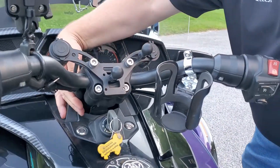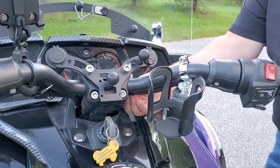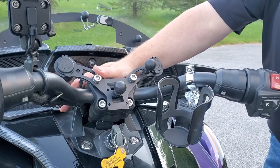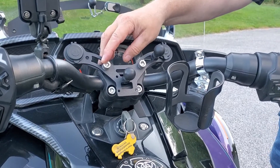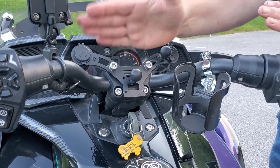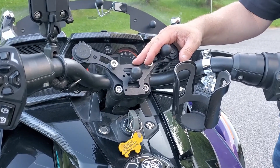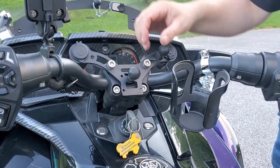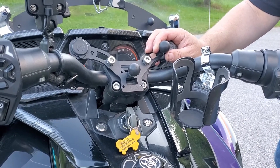Put your piece down, put your handlebars and clamp down using your longer bolts. In most cases you may have to pull just a tiny bit on your cables — there's plenty of room and the cable length is just fine on all of them. Then put a little bit of blue Loctite on your bolts, put your bolts in, find your exact location — there's a little bit of adjustability — and when you tighten, tighten opposite and opposite and tighten it down real good.